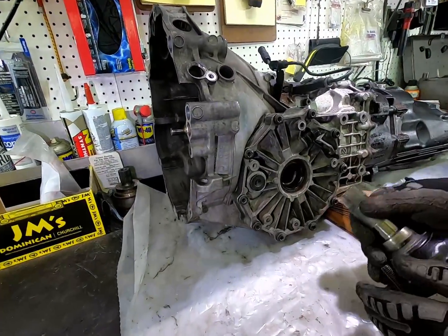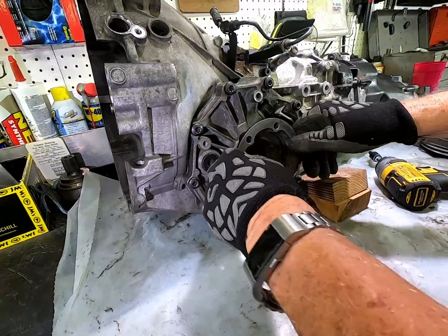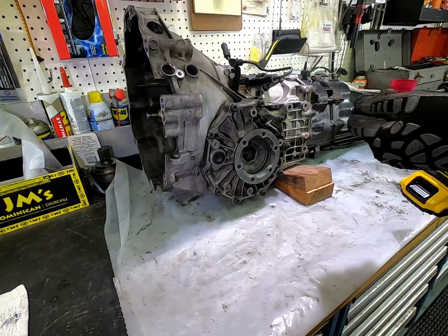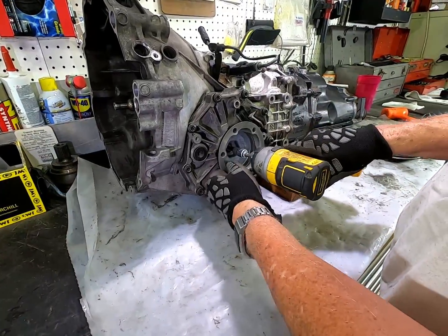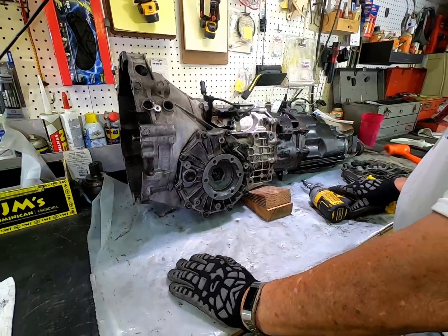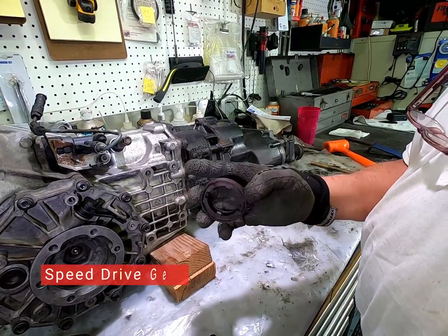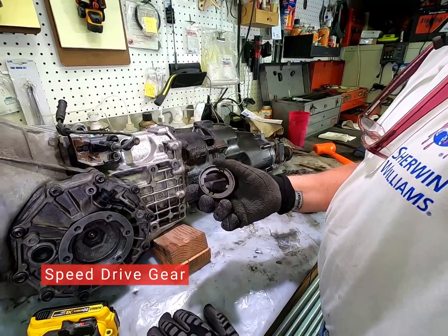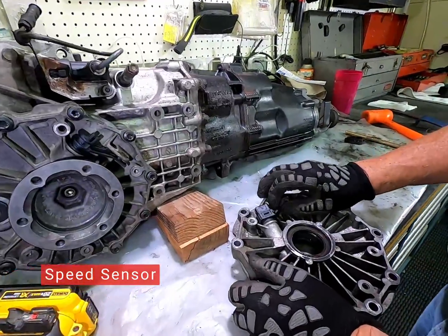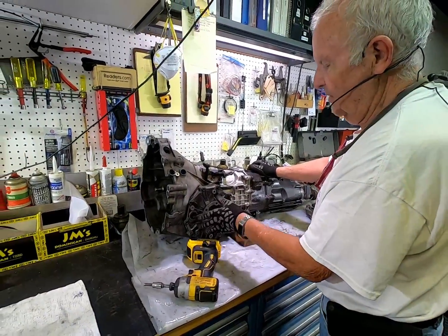Your drive flange is geared — it fits into the gears inside your differential. This center bolt is torqued to seven foot-pounds plus a quarter turn. The piece that fits on your differential is called a speed drive gear — I like to call it a hall sensor because it's basically just magnets. The part number is 01240 9187D. The speed sensor is 01240 9191D. These are my thoughts and this is what I do — you don't have to.